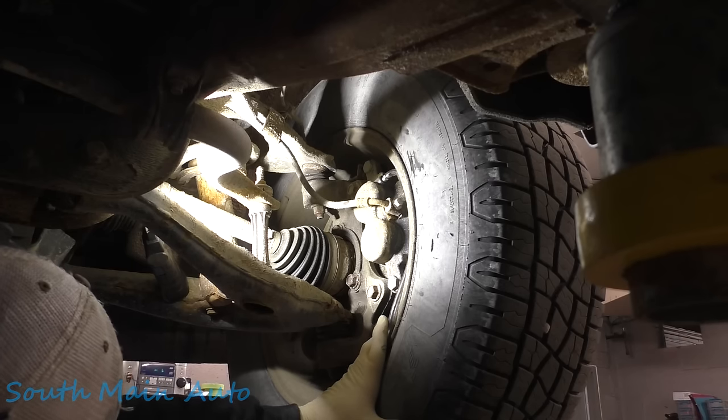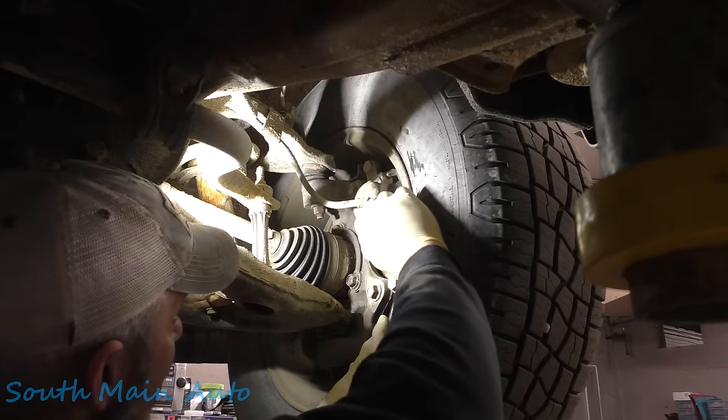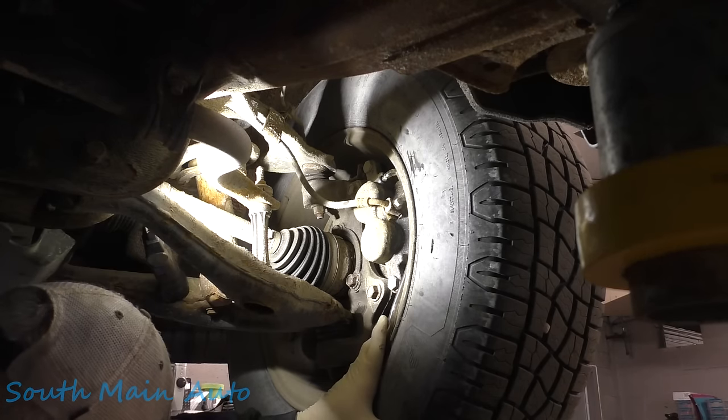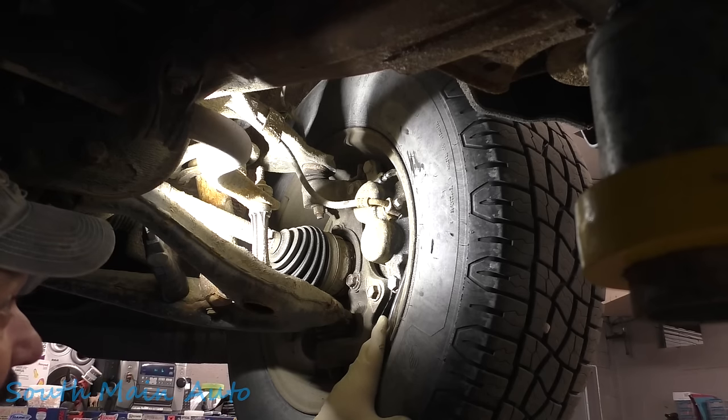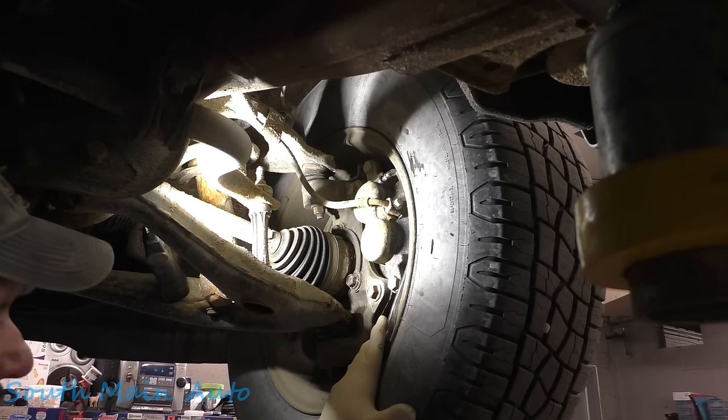Okay. Connect the bleeder bottle to the right front bleeder screw. Open the bleeder screw. Brake fluid will be under pressure. Warning. Okay, it is open. It continues. Whoa! We got a squirter. There's some air. It's on a 60-second countdown. Lots of noise going on over there. Not really pushing a lot. Oh, there's some air. Oh, there she goes. That's why I like using a clear hose, because you can see when you got air coming. Yeah, lots of air coming out of there now.